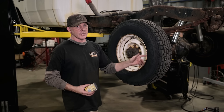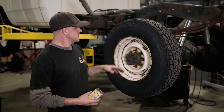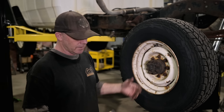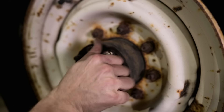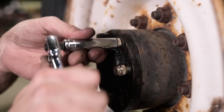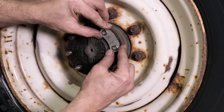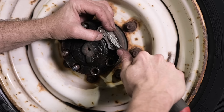We got the Radflow shocks installed, and while this thing's still up in the air at chest level, we're going to address these axle flange nuts. One of the things that can happen with heavy, heavy use on these full-floating rear axles is the nuts can back off and allow the axle shafts to walk out. We're going to install these Stage 8 locking fastener kits back here. Once we tighten them down, they'll never move. The locking tab indexes on the bolt heads and keeps the bolts tied to each other so they can't back out.